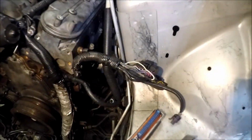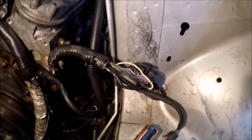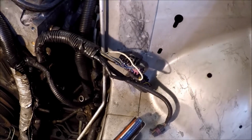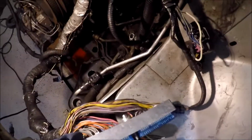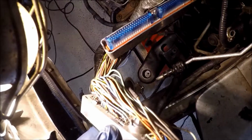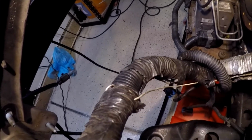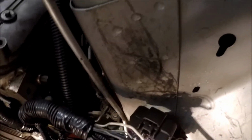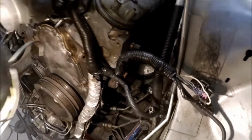So here's a couple things that are really sketchy about this particular car. Mostly the wiring harness. That is a butt connector there. Here is the main PCM connections. This one looks fine, but if we go into this one, you can see it has random writing on it. And at the end there, there's a butt connector, so that's kind of sketch. And then you have this random wire that is like just going up here. Presumably it's this one, I don't know. But a little sketchy. And I had the luxury of whatever wire this is down here, this little nub.